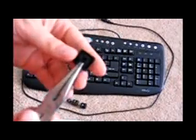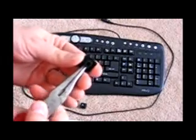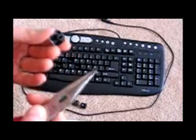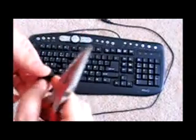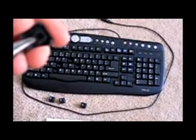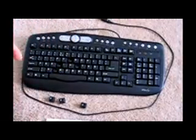To remove the guide from this key — and if this doesn't work I'll be out of a keyboard — it looks like it's coming off quite easily. I'm just twisting it; I'm not putting any pressure on the actual column, and it comes right off. We do the same thing with the other index key, which would be J. I'm going to grab it with the needle-nose pliers and twist either way — righty tighty, lefty loosey. It should come off pretty easily. You should have a pretty clean edge, and I can use sandpaper if there's anything left that gets in the way.